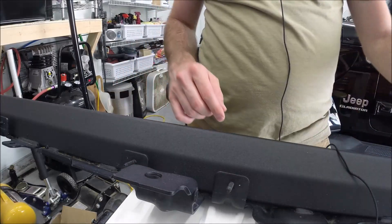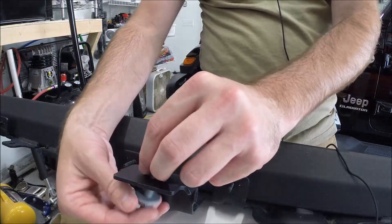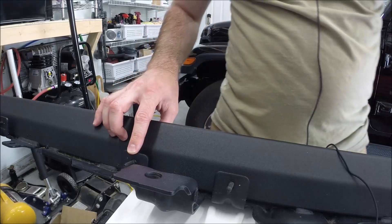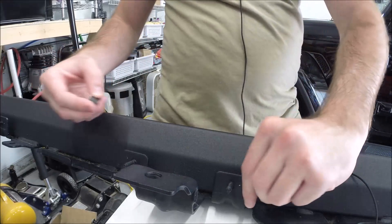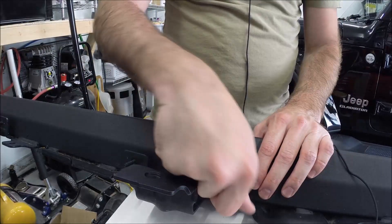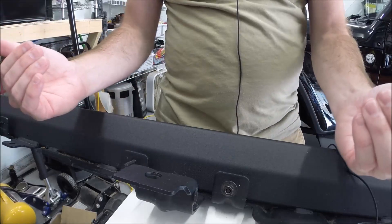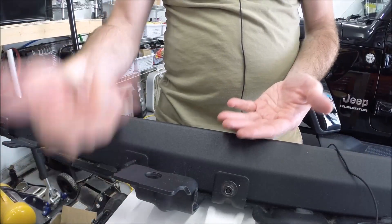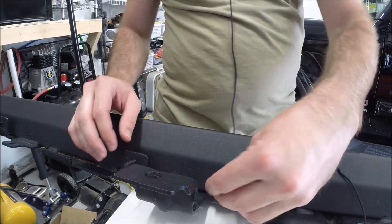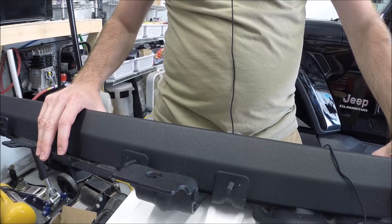So this is going to be one of the mounting points. There's one bolt that comes up through here, and then you also have these two alignment dowels — these are captured bolts welded to the rail, and the nut fits on those. These help hold it up to the pinch seam, and this bolt supports it vertically to the body of the vehicle.